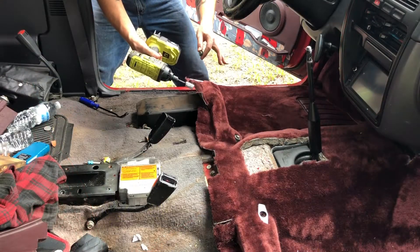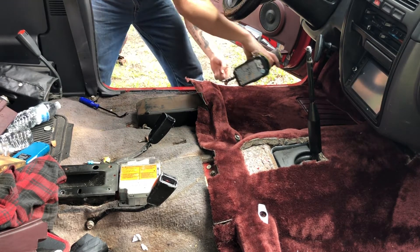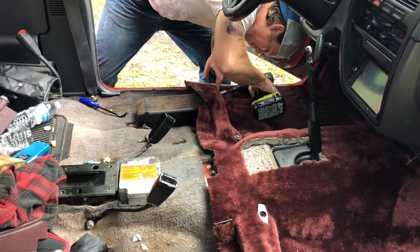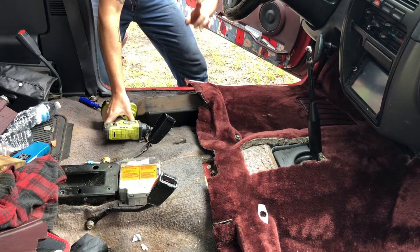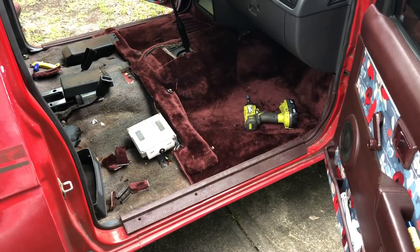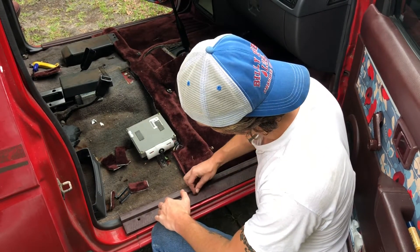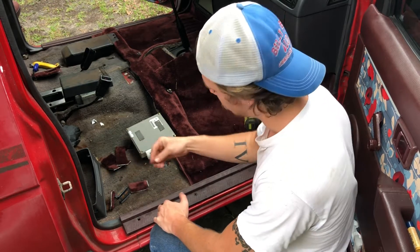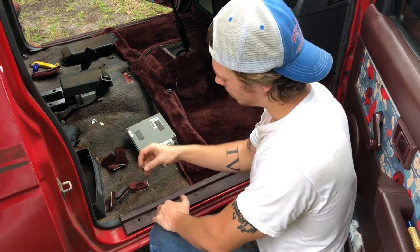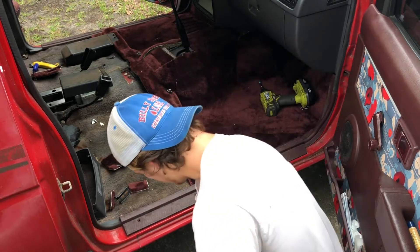One of the easiest things to do when installing the carpet: make sure it's stationary, get all your angles right, then take your seat bolts and install them in the holes. Make sure you don't tighten them down all the way though, because you still want some movement while installing. I actually found it easier to pop out the tabs, lay it down, then poke the tabs in and then poke the screws in — the tabs were having trouble seating because they've been expanded over 20-some odd years.